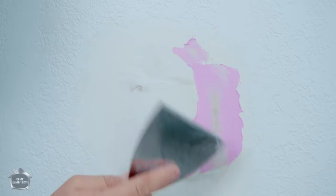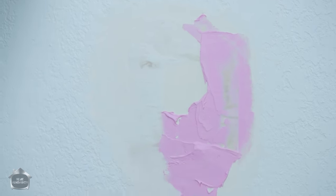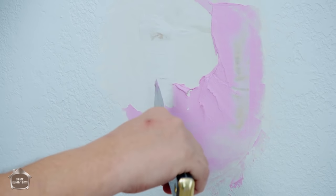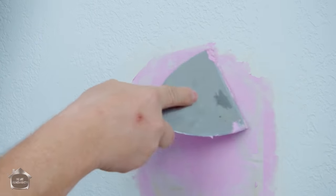Put pressure on the knife tip right on that ridge line to smooth it out as much as possible. Using this different color material helps identify the highs and the lows. One time through the middle, a little bit left over here and there - no big deal. We'll take the sanding sponge before we prime. Same thing with the hole down here - be a little generous with it to make sure it's nice and smooth.